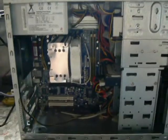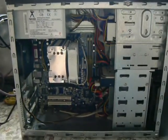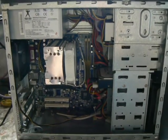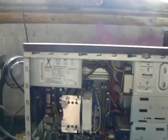The change of operating system also means I'll be able to use this as a print server. I was never able to get FreeNAS to work as a print server, so I'll be very pleased to finally get that up and running. The intention is to keep this running most of the time, so I'll probably upgrade the power supply — it's a good power supply but it's just getting a bit old, and I think we really need to get an 80 Plus rated one in there.